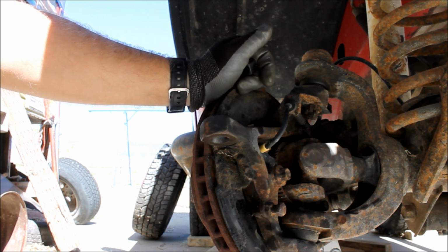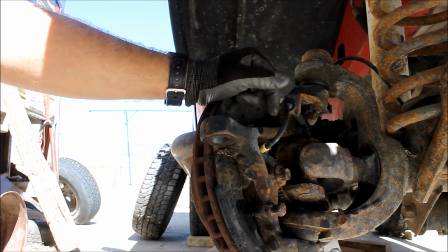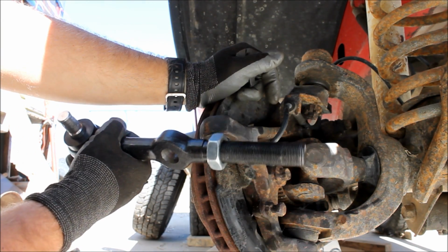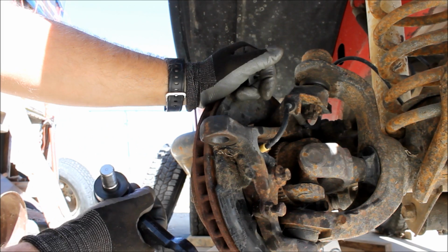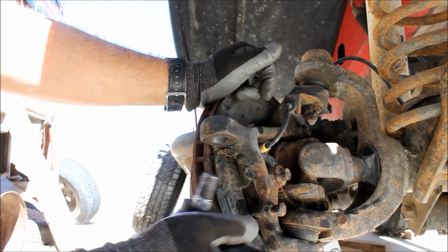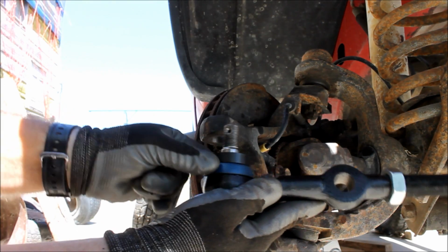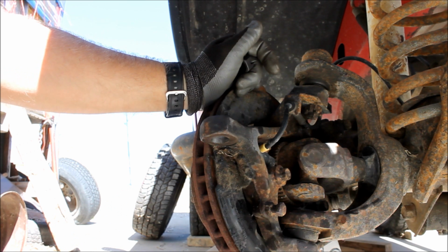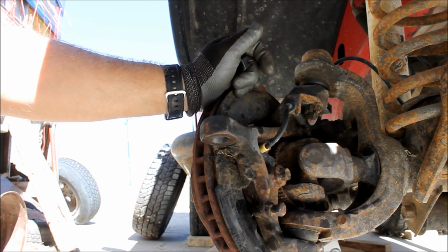Now lucky for me, I have another axle squirreled away that has, as near as I can tell, this same style of knuckle. It's off a 92 YJ. So I've pulled that knuckle off of that axle. I'm going to go ahead and ream it and be very, very careful that I include this spacer in my test fit. And hopefully I can get this off and just replace it.